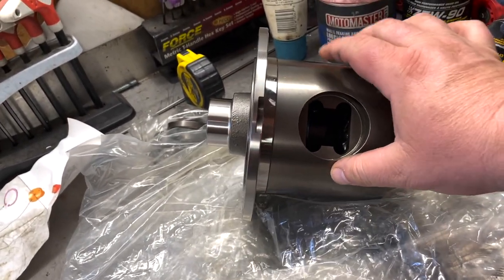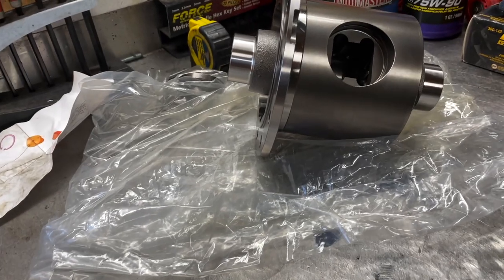I personally have experienced that I can go a long ways in two-wheel drive before I have to engage four-wheel drive because of the TrueTrac itself. Once it starts to engage I can just keep trucking along, up to a point when the rear just starts spinning — then I actually have to engage four-wheel drive, which makes it really nice. If a person would have a two-speed low in their Jeep with the TrueTrac, it would make it an even better combo.